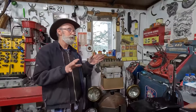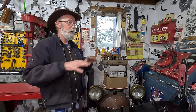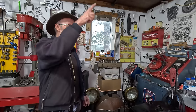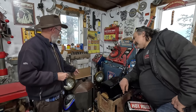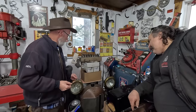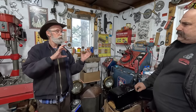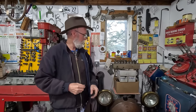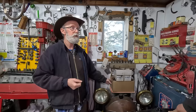So this is Scripps Booth. This radiator was in a barn in Chilliwack. The guy was having a sale on all the stuff in his barn because his uncle had passed away — this radiator was up in the rafters. I spotted it, told the guy I'd like to have it, he took it down for me. I had no idea what this radiator was for — it just had a V-shape and I wanted it for my speedster. I dragged it home and I'm looking at it — it's got two water holes for rad hoses on the bottom and one in the center at the top, which is odd. Most have one at the bottom and one at the top — hence one water pump, one way in, one way out.